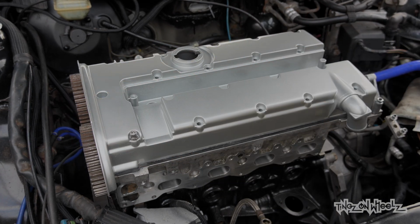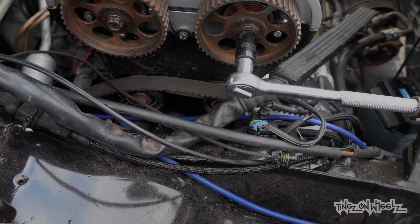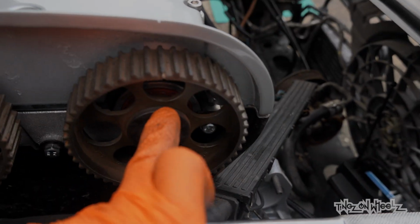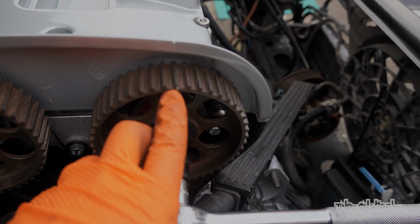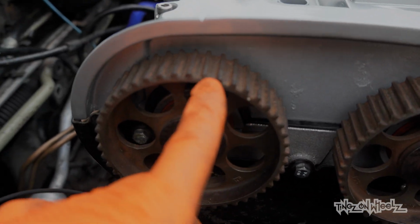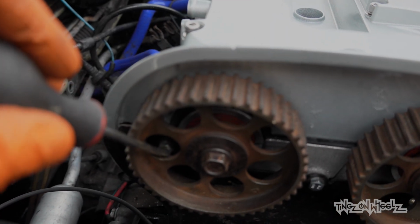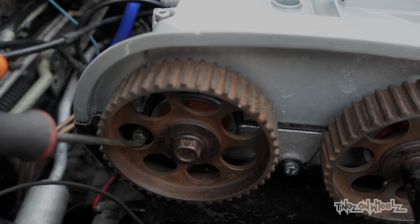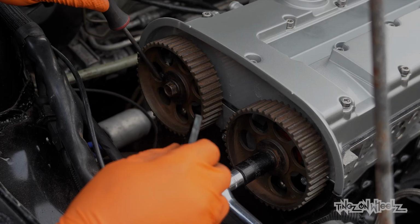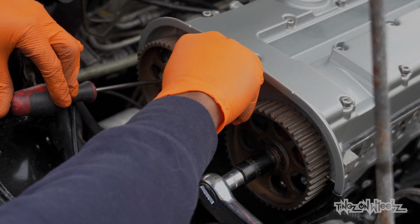It's easy enough. And you can see it's coming along. Right, so don't watch this. I've got a ratchet that's being held by the slam panel to keep this timing mark in line with that. Then on this side, you can see it's slightly off with that one. So what I'm going to do, little screwdriver, and lever that, and that'll get us in line. And then you'll see what I'll do next. It's the valve springs keeping the cam in its position, so no harm done here.